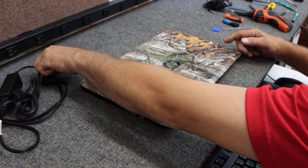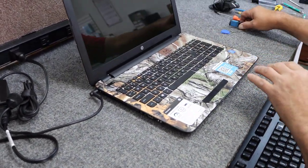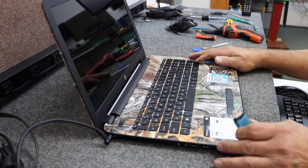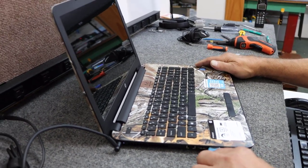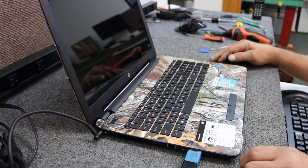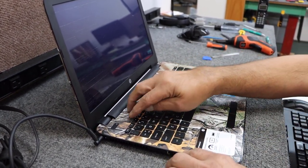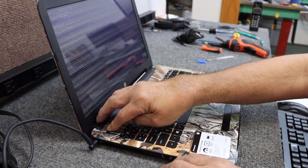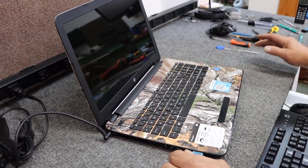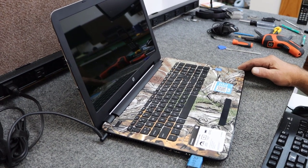Let's put the optical drive in and do a clean install of Windows 10 2004 edition — get all the updates, install a couple browsers. Go ahead and plug in the power cord. I'm going to put in my USB Windows 10 installation drive — I'll have a link below to a video on how to make one; it's free, just download the media creation tool from Microsoft. It should by default boot off that drive, but sometimes you have to hit F9 to get the boot menu. I grabbed a different drive — I think I was having issues with the first flash drive. Let's turn it back on and it should boot right off this flash drive.